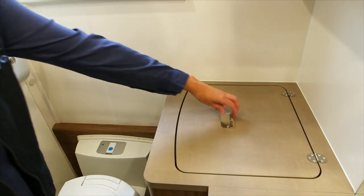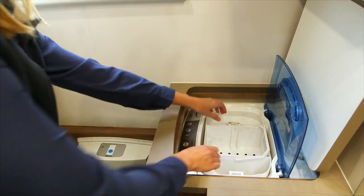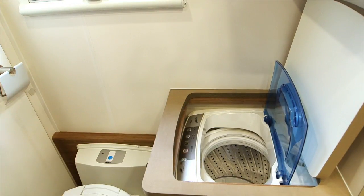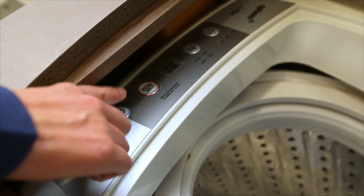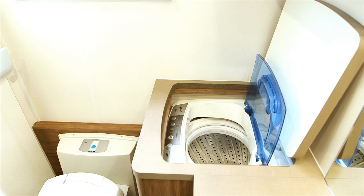The Sphere 3kg washing machine has 5 programs — from a wash-rinse-spin cycle lasting approximately 38 minutes, to a simple spin cycle lasting approximately 7 minutes. Wash settings are set via the control panel. To wash clothes, select the proper water level according to the quantity of clothes. Select the program and process, close the lid and press the start/pause button. For more information, refer to your washing machine operation manual.